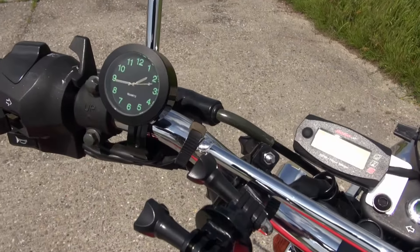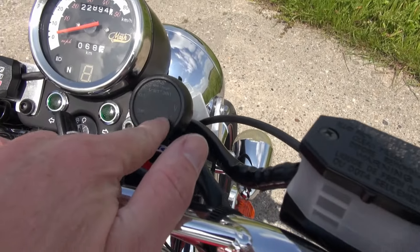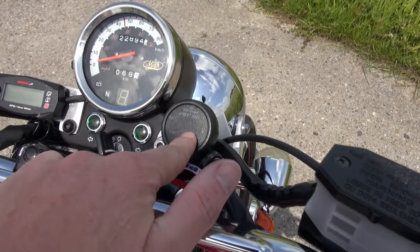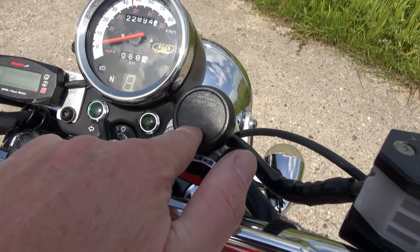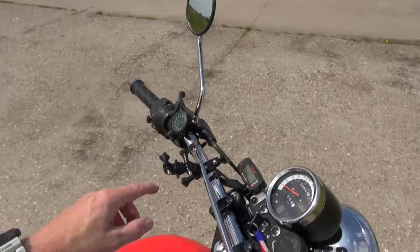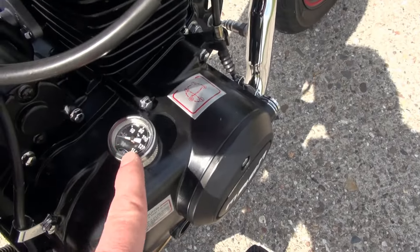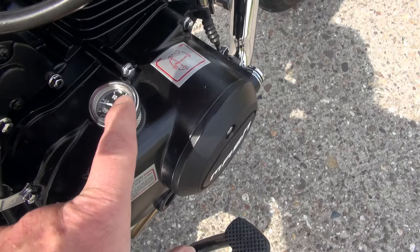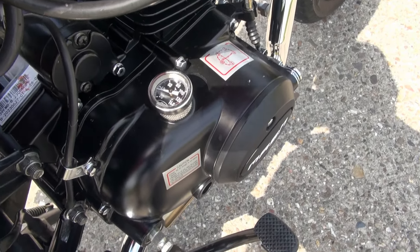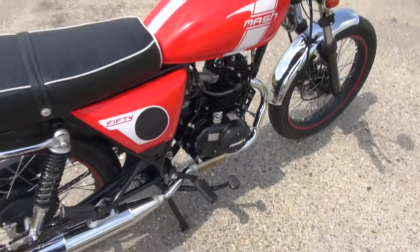I see that as part of the hobby — performing maintenance and making small improvements, like adding accessories. I added this clock, which is very nice quality and watertight, a voltmeter, and a small temperature gauge — though this one is Chinese, so you have to add four degrees to get the actual temperature. It has a USB port so I can charge my camera while driving. This oil temperature gauge comes in real handy: at normal driving speeds oil temperature is 70 to 80 degrees, and on really warm days driving fast without wind it gets up to 90 degrees.